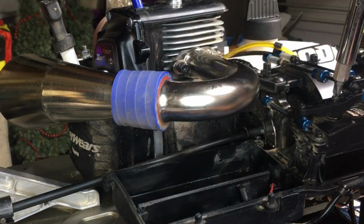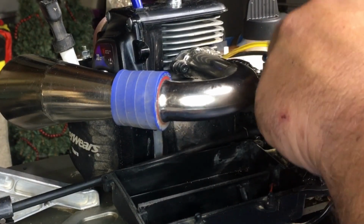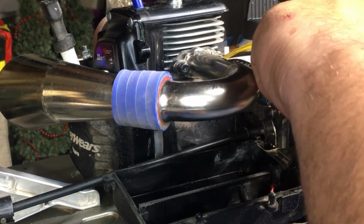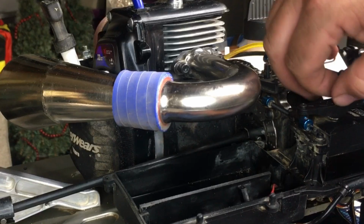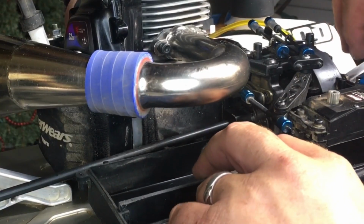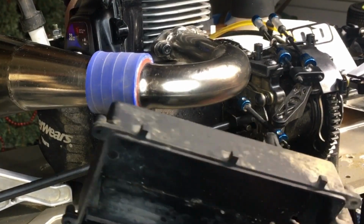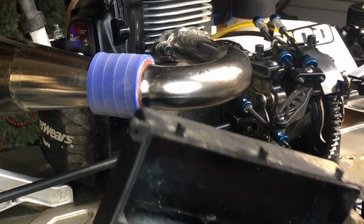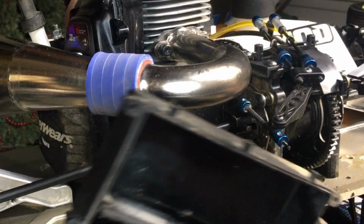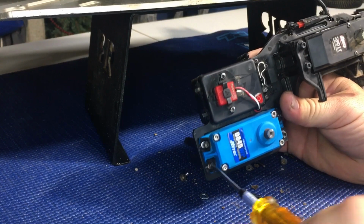Now if you just put your servo horns parallel and horizontal with your servos, that way you'll know exactly the way it goes back in, and you don't have to readjust everything. All right. Now that our tray is out, we can go ahead and remove our servo. We will now remove the 2.5 hardware that is on the factory servo.